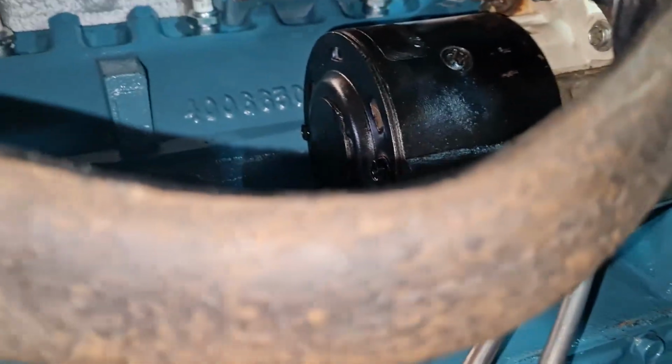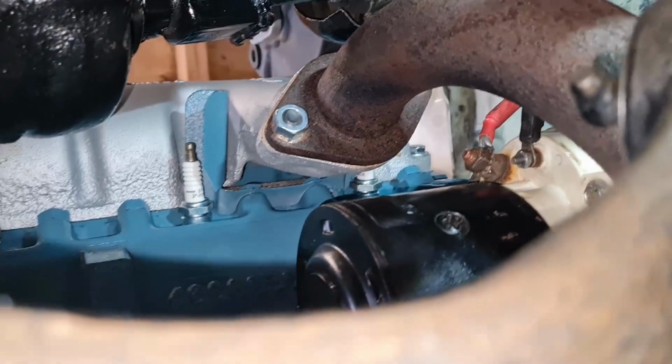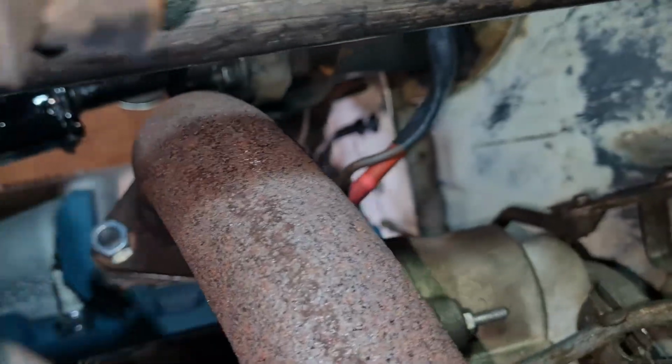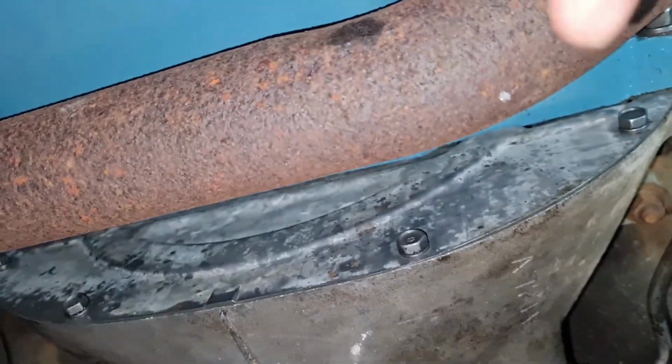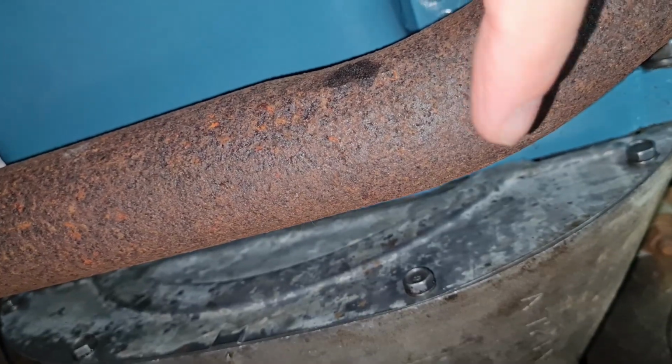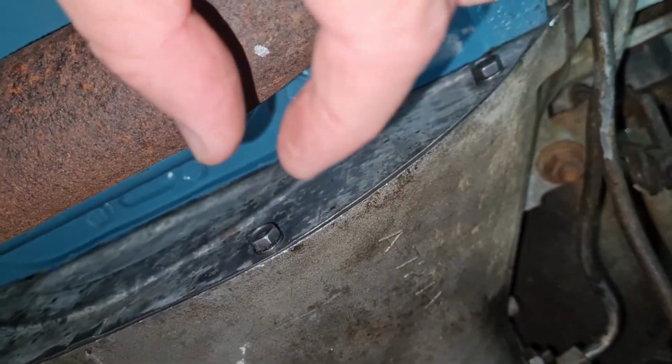Banging. Right, so the next day, we're up underneath. So we're under starter's orders. That's in, that's done. The exhaust pipe to exhaust manifold, that's in. New bolts, they are torqued up to 50 foot-pounds, which is what they should be. Right, flex plate. Now, obviously that's in. The torque converter bolts, they're in. Now, bearing in mind, they're only like a real tiny little bolt, okay?